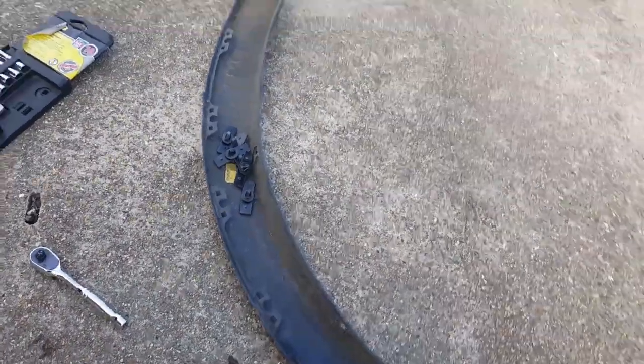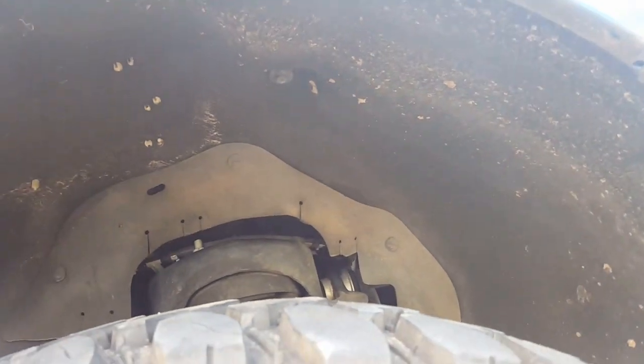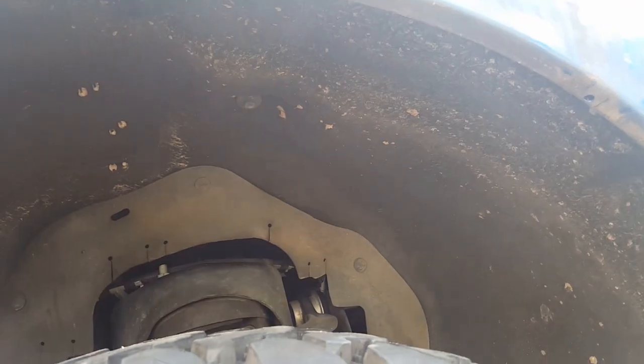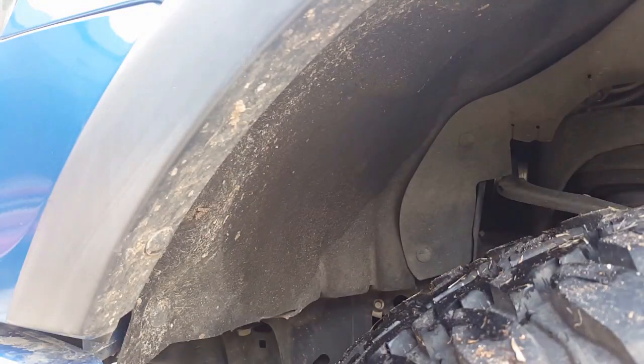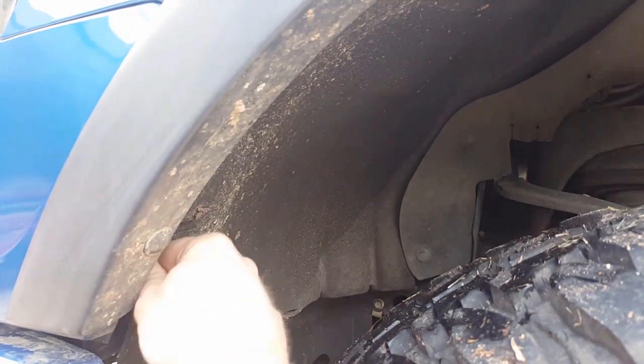The other provisions it has are these little push pins. What I'll do, I'm going to go to the parts store and see if I cannot locate some push pins. There should be 16 of them, from front to back and side to side. And I will post the part number, probably from the help section in the parts store. I will post the part number below this video in the description section. The thing we're going to do is take the two nuts out of the front fender, it holds the flare on.